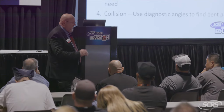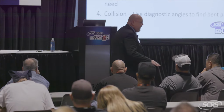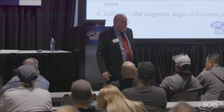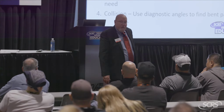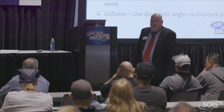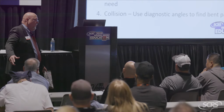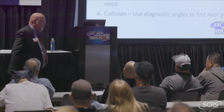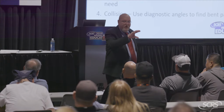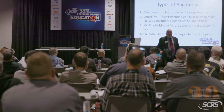I've got a hold of these modified guys, and they don't realize that when you elevate an F250, 350, 6 inches, that's got a camera up in there, that camera might see over one of the lower vehicles that would be out there. And what does that camera run? Well, it's lane control, pedestrian recognition, color recognition, size recognition. If it sees something getting closer, that means what? It's getting bigger in the camera. So the size recognition is really critical, but where that camera is aimed is even more critical. At the end of the day, you're dealing with autonomous braking. What could possibly go wrong?